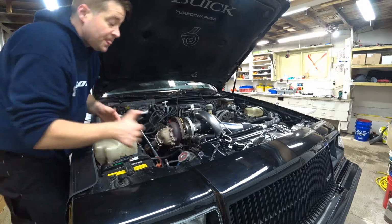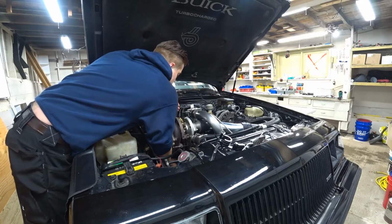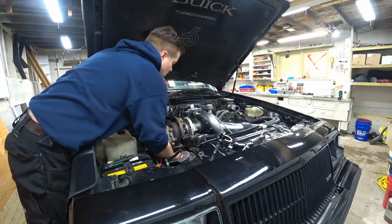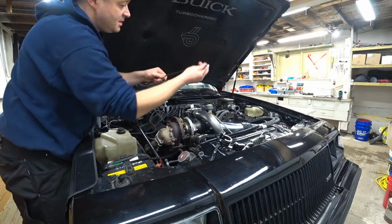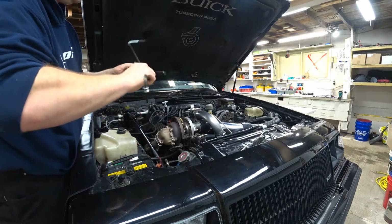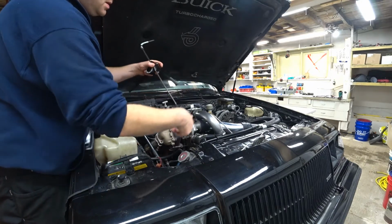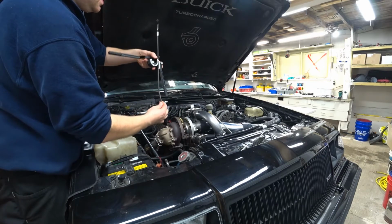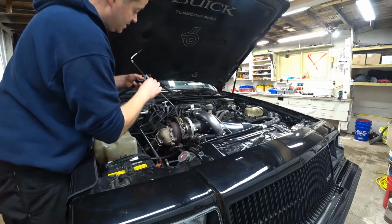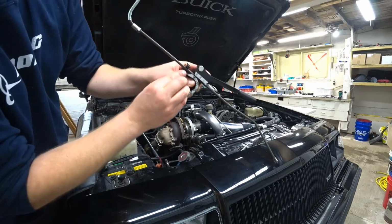So I'll make one mark there, take my tube off, slide my nut up, because we're not going to go this far and make that mistake. Stick the tube in the tool. I'm going to sort of line this up. Have my mark right there on 0. But again, I need to slide it up about 3/4 of an inch. So maybe I'll line the mark up with here rather than lining it up with the 0 marks. There's my little mark. It's hard to see.